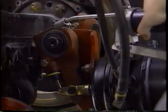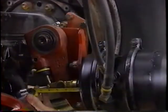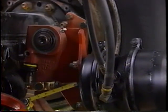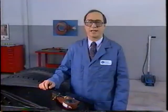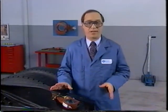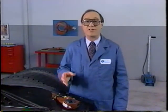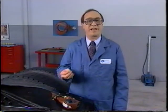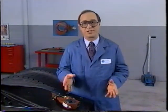For preventive maintenance, begin by again checking the free stroke, or applied stroke, of the slack adjuster as shown previously. If the stroke is correct, the slack adjuster is functioning properly. Now let me note that it is normal to see variations from brake to brake during the applied stroke. It can be plus or minus 1/8 inch.